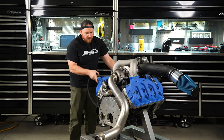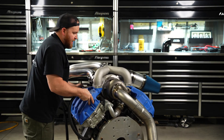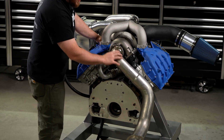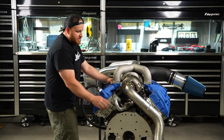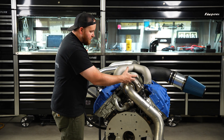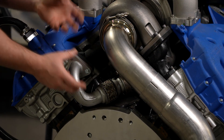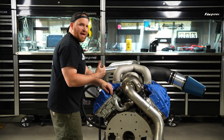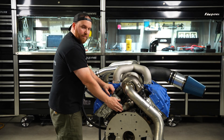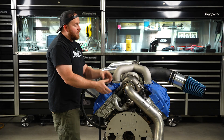On this engine you can see how we like to do our hot side. We have the hot side here — obviously you've got your downpipe. We utilize a factory style driver's side uppipe; this never changes. When you do the kit, you get the passenger side manifold and everything integrates, so you have no crazy uppipes wrapping up around. There's a massive loss of heat with those long uppipes, which hurts spool time — so we eliminate all that. We now literally have one uppipe, removing one out of the equation. This is the same on our S300 Emperor and the S400 Emperor.